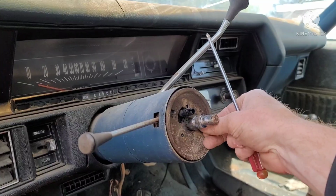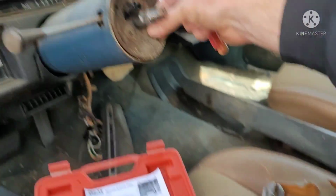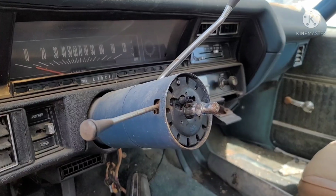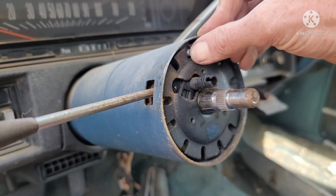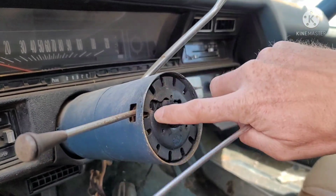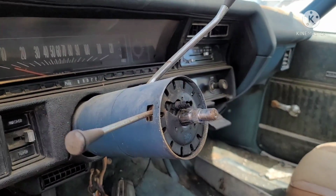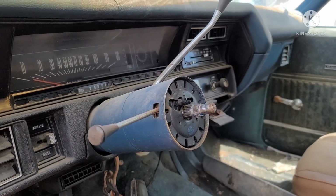If you don't have the lock plate tool, this little one with the green knob, you can actually, if you pop that wheel off, you can take this little guy as the spring tab and you can push that in with your screwdriver, and you can actually tear a pop can and slide that between there and tape it to this column around there, and that will undo your column.